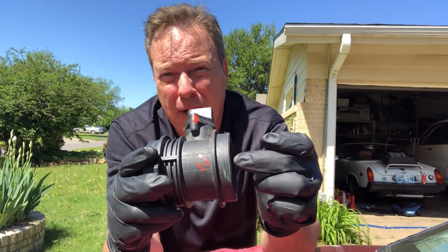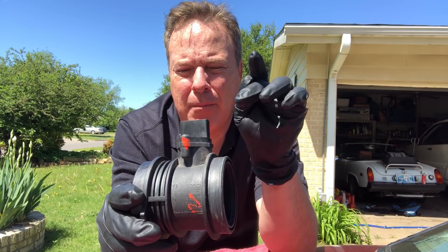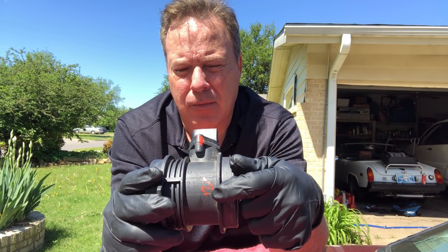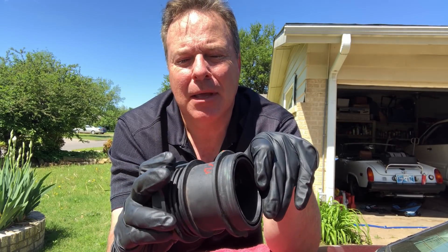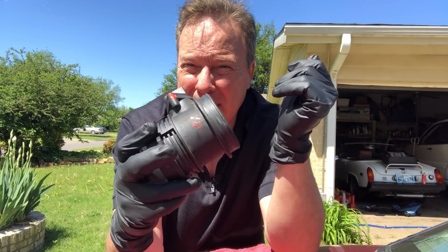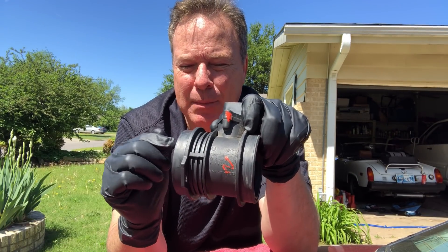See this one that came off the car — see the marking right there and right there? This tells me that this is from a junkyard. If you go to LKQ or some of the other pull-aparts and you buy one of these from another car and pull it off yourself, when you go pay for it they will put a little paint mark on it. So in case you have to return it, they know that you actually bought it there. Not the most sophisticated system, but you don't know what you're getting when you buy something like this from a junkyard. A part like a fender or a hood, you know what you're getting. Something electric like this, you don't. Always keep the mark on there and keep your receipt, because you do want to return it if it is bad.